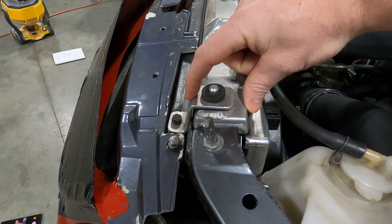Moving down the side of the car, these are side skirt extensions — actually from Menards, these are gutter aprons you can buy for three or four dollars. It's a perfect paint match for a gray Evo 9, by the way. I just attached them to the bottom of the side skirts. All that low pressure from the splitter going underneath the car — you want to keep that low pressure underneath the whole way. Extending the bottom of the side skirt down as low as possible to the ground helps keep that air underneath and stops higher pressure air from coming in from the side. These here are vortex generators. They create a small vortex off the back to help keep air stuck to the rear window. If you look at the angle of the roof compared to the back window, it's kind of abrupt, so air has a hard time staying attached up there. Anytime you have detachment you get a bubble which creates drag. These help keep air stuck to the back windshield, which also helps keep a straighter flow to your rear wing.